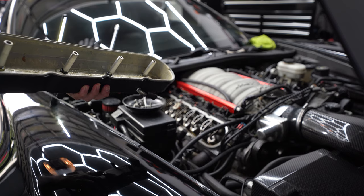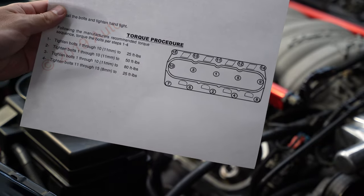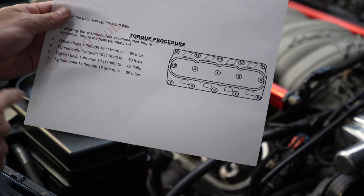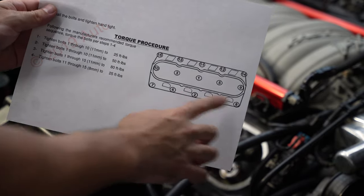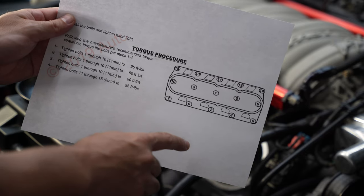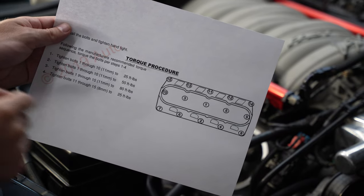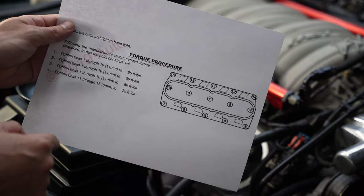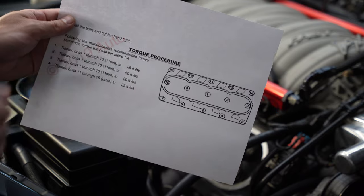I'm going to check the torque on the heads just because I found that head bolt to be less than 22 pounds. I'm going to torque them and follow the process. I went ahead and printed out the procedure. You do 1 through 10 at 25 pounds, then back to 1 through 10 at 50 pounds, and lastly 1 through 10 at 80 pounds. Then there are bolts 11 through 15 up by the intake manifold, but I'm not really focused on those just yet. Right now my emphasis is on 1 through 10. Make sure you follow the diagram — don't make up what your 1 through 10 is. So 1 is dead in the middle, 2 is right beneath the header, back up to 3, 4 is to the side of that. These header ones might require loosening the header — I'm going to try to avoid that and see if I can get a socket in there.